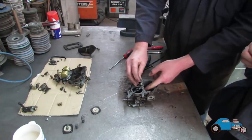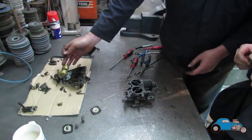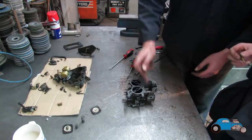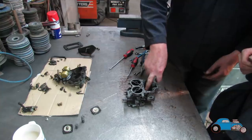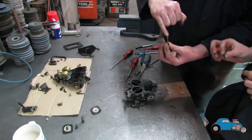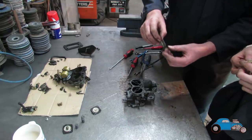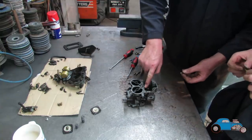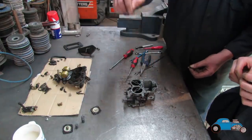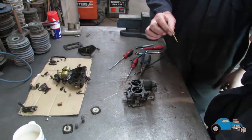These are the emulsion tubes — they sit in here. In here is your fuel, governed by your float. When it fills up it shuts the valve off, fills it up to the right level, and keeps going up and down letting the fuel in and out. Fuel goes through there and comes up. In here is an air jet, and the air jet allows a certain amount of air to come down. You see these holes? They create air bubbles in the fuel — it puts a mixture of fuel and air into the fuel, then sprays it down through this venturi and into the cylinder. All they do is put air into the fuel.